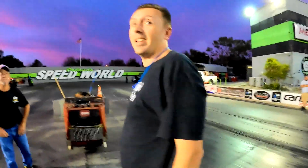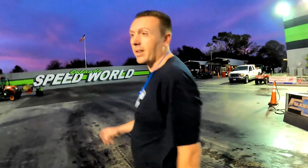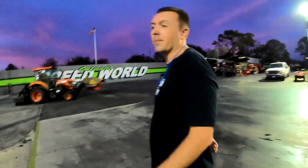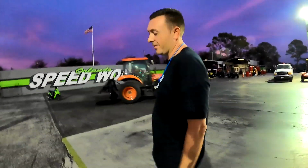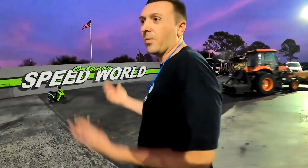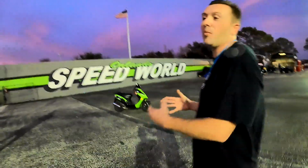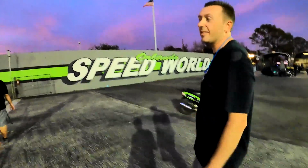Yeah, it's not a real world comparison, really. Well, not a real world mod you would want to do. At least at this power level. Yeah. When we add power. That's what I was thinking, you know, if we throw a pulley at it and start making 20 pounds of boost, where that ported blower should really start shining, at that point maybe that ram scoop in the front of the engine doesn't give it enough. Won't really matter much anymore. No, it might be more of a restriction than a benefit.